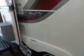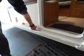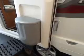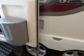This is very important: check your wheel nuts each time you go away. It tells you on your plate down here. So alloy is 130 Newton metres. There's a steel setting also there, but obviously you want the alloy. Making sure you are checking them regularly. I tend to do that before each time I go away. Do you get them caravan checked yourself? Yes, I do. I've got my torque wrench. I will check them before you leave. Right, okay. Keys.